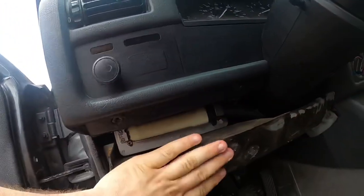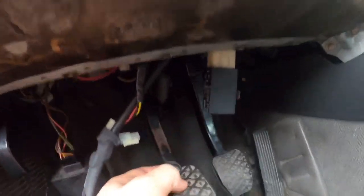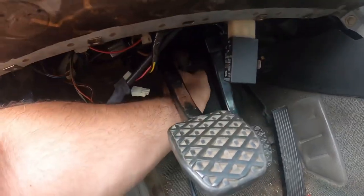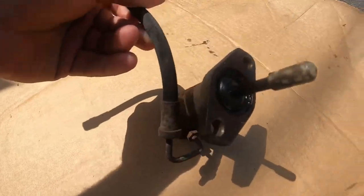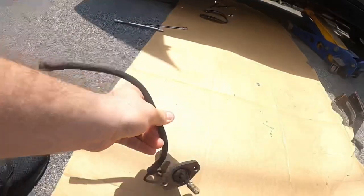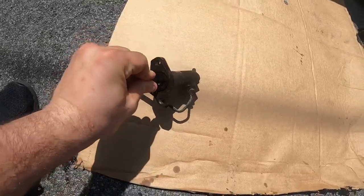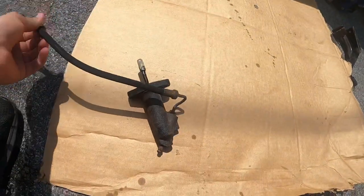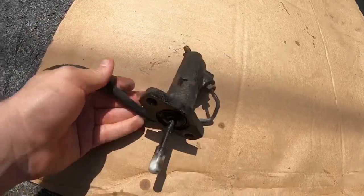The first thing we did is take off the two plastic covers over here. The first one has three bolts plus another four down below, and then you get to the master cylinder. The slave is out — and it was leaking right there, from this little ball joint fitting. The line itself seems in pretty good shape except for the rusted-out end bolts, but the slave cylinder is the one that's the problem — that's why I lost all pressure in my clutch when I pushed it down.